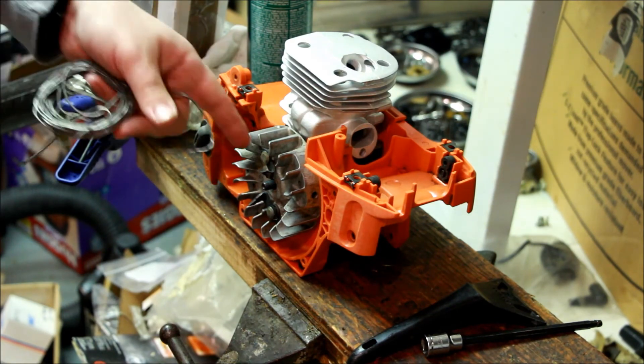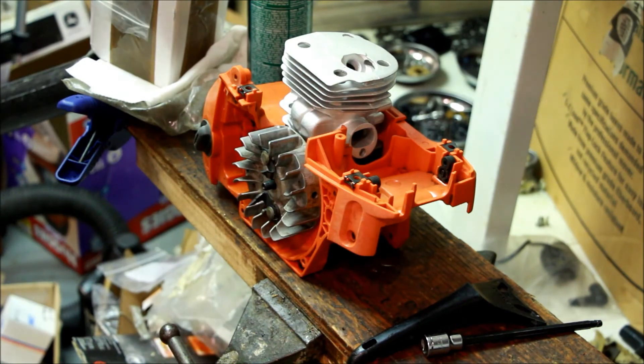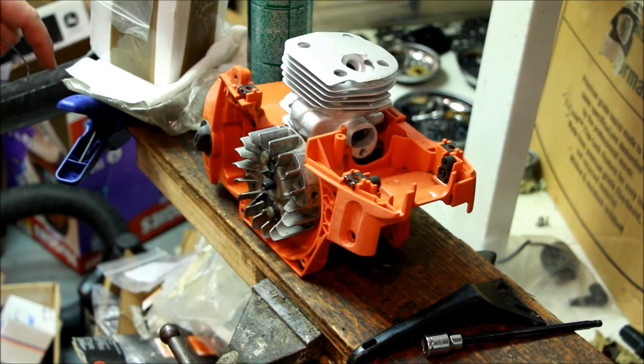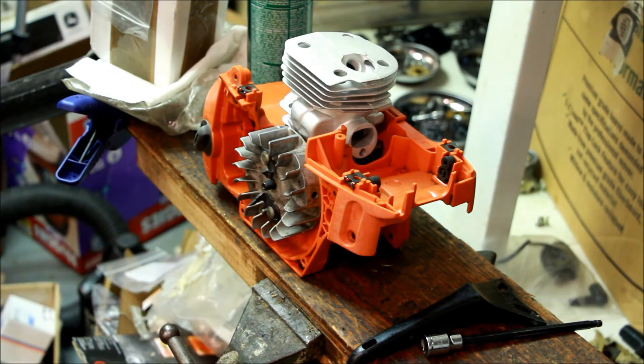I think this kit - at least the squish - seems to be fairly comparable across all the kits. The Kefar kit is the furthest off, but none of them are grossly out of spec, so it's at least interesting. Even with the aftermarket riser and all those confounders, it's not that far out of spec. It's nice to see that even the aftermarket stuff isn't too far out.